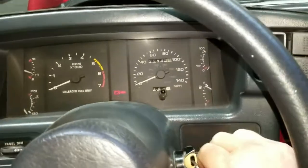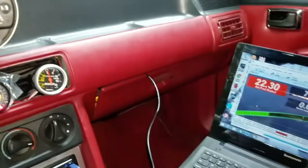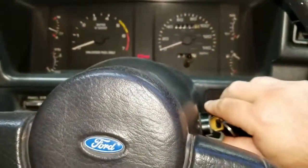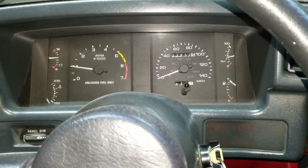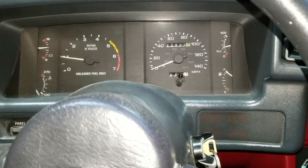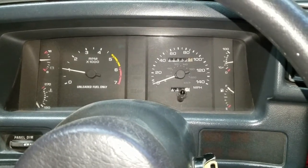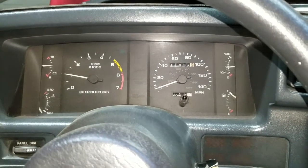Alright, we're going to go ahead and start the car up. It's getting closer to where it starts up very easily, and we got the computer linked to the MicroSquirt, so we're going to go ahead and just crank it over. This car's got a cam as you guys know, and the idle on it is pretty well locked in, but it does surge a little bit when it's on its warm-up enrichment stage. So we'll let it kind of do its thing here.